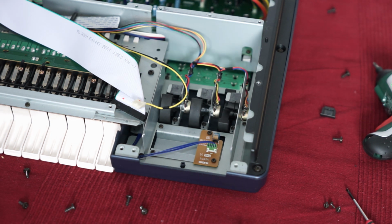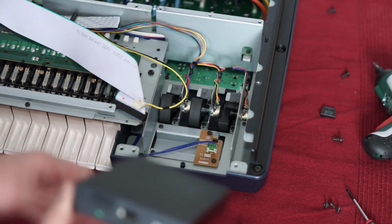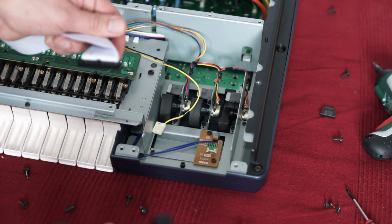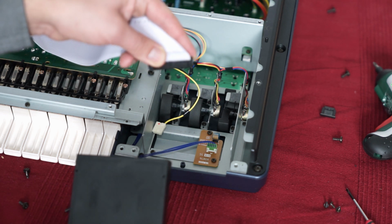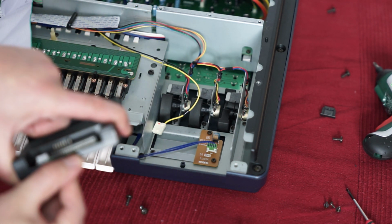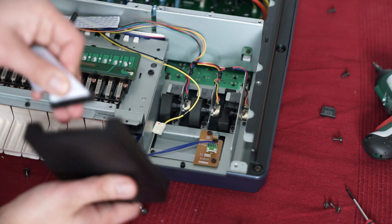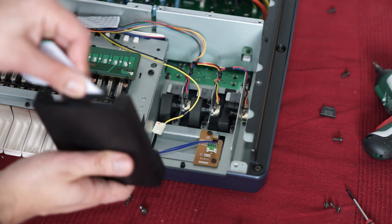Now, when you install the floppy drive emulator, place it around like this. This is the right direction. And when you connect the cables, see the small notch over here. I hope the camera is in focus. This will have to face upwards. So there's also a small notch over here, which matches the cables. So just take the cable, which is in your EX5 and was connected to the old floppy drive, and plug it in here. Carefully watching for the notches to match, okay?